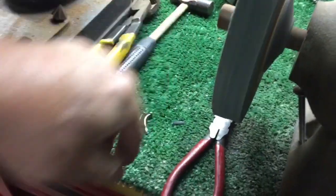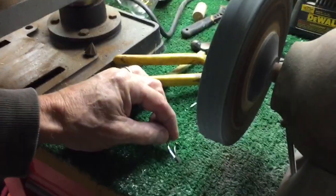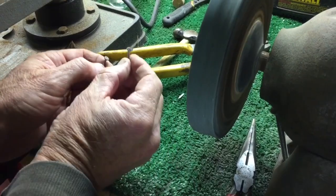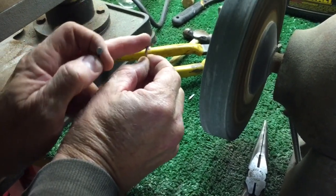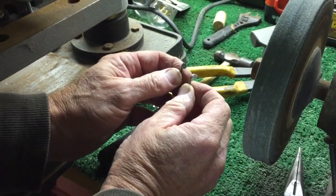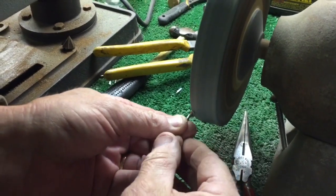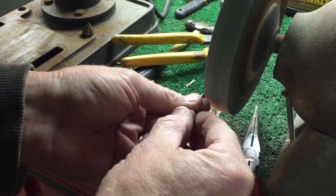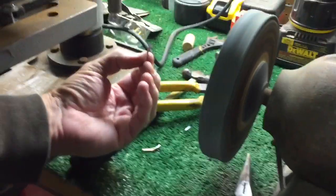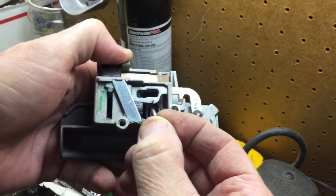Now it's the right length, but I'm going to smooth it out a little further. This one here has to go a lot further, so I made it shorter and ground it up far enough. The last thing we need to do is take off almost half of the nail head, because the top of the head hits the plastic on the door when you lift the handle. So we simply put it on the grinder and grind that part off. See that line going straight up and down — you can see where it needs to be flat.